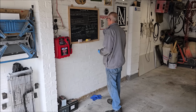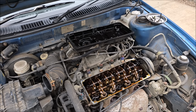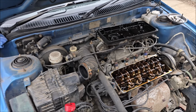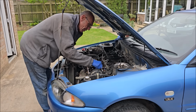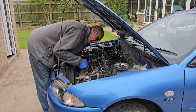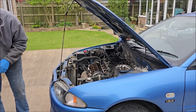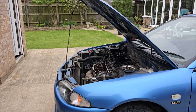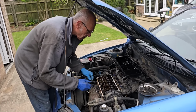Oh dear. Exhaust. So just talk us through it. You've got your feeler gauges. Yeah, I'm checking the amount of gap clearance. It's between the valve stem and the rocker. But it is tight, so we'll adjust it while we're there. Now I'm in English money, and it's usually a bigger gap on the exhausts. Yes. So the exhausts are this side, look.